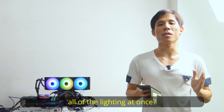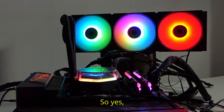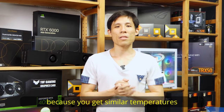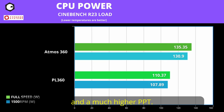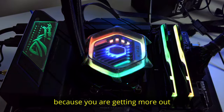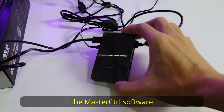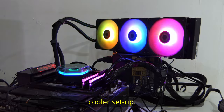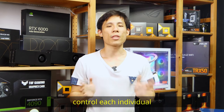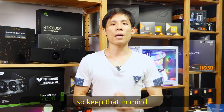So yes, this is a pretty good cooler. Even though the temperature delta on this Atmos 360 does not differ much from the PL360 Flux, you get similar temperatures but at a much higher boost clock and a much higher PPT — it's pushing the 7700X to perform much better even at similar temperatures, which is always a good thing because you are getting more out of the CPU. Besides the performance, I'm still not a fan of using the LED controller box because there are too many wires to manage and the Master Control software is still pretty buggy. But when it works, you can have a pretty snazzy looking cooler setup. I would still prefer to use software such as ASUS Aura Sync to control the lighting, even though I would not be able to control each individual part's lighting. For warranty, at least for Singapore customers, Cooler Master has given this cooler 5 years warranty — I'm not sure about other regions, so keep that in mind should you ever want to buy this cooler.